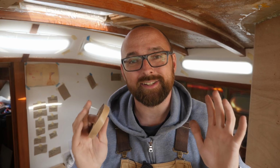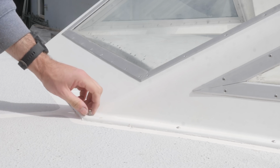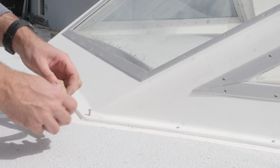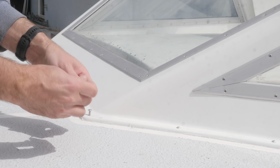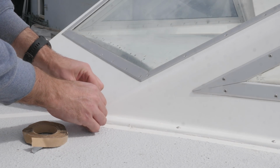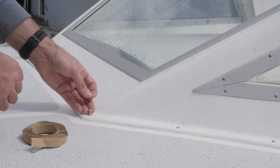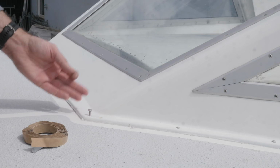And that is awesome. Now I can just go ahead and loosen each of the bolts and apply a little bit of butyl tape around the head, and that should be watertight. I've loosened this little guy here from down below, so now I'll just take a thin little strip of butyl and wrap that around the head and tighten him back down, and he should be waterproof.